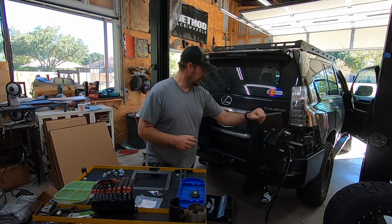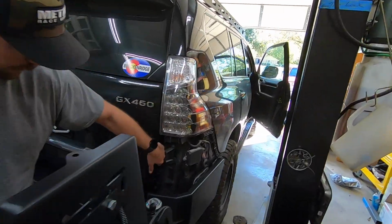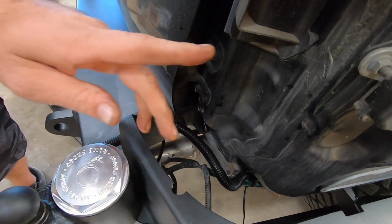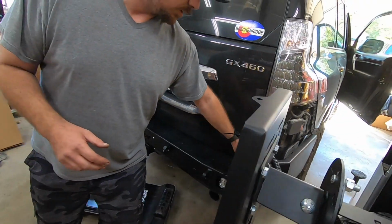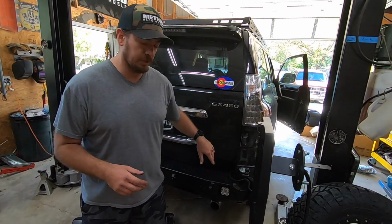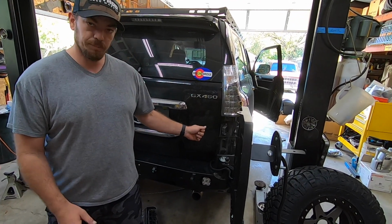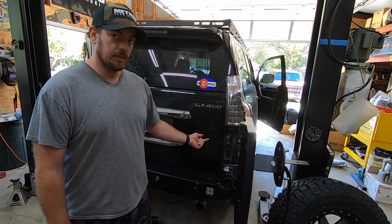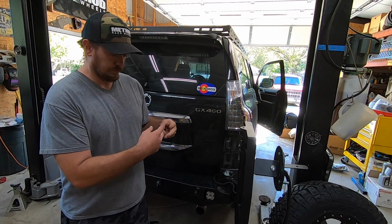So what we've done is trace a wire through the accordion cable in the rear door into the quarter panel here and then down. In the instructions from the manufacturer, they have you pull out this whole interior panel. I had better luck using a pokey stick up through the grommet in the bottom and grabbing it from the inside through where the power port is.